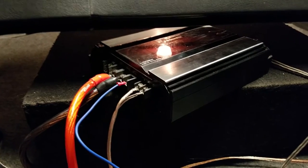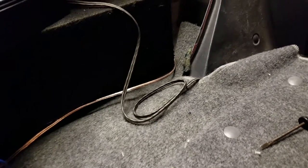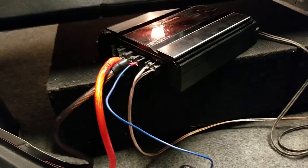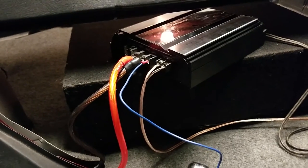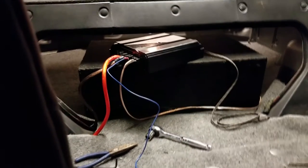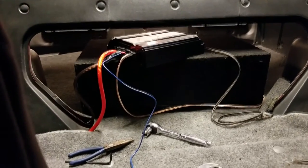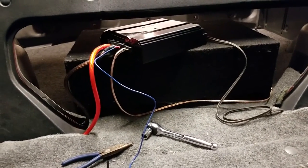We have power, ground, and I've run the speaker wire to the actual subwoofer itself, and our RCA cable is connected. I completely forgot — it's been a long time since I installed a subwoofer in a car — I forgot to run the remote wire that actually turns the amplifier on when you turn the car on. So I am going to have to pull apart the center console once again and pull the rear seats so I can run that wire nice and clean. I am going to do that later. Right now I am going to go get something to eat because I have been at this for quite a while and it is starting to get on my nerves.